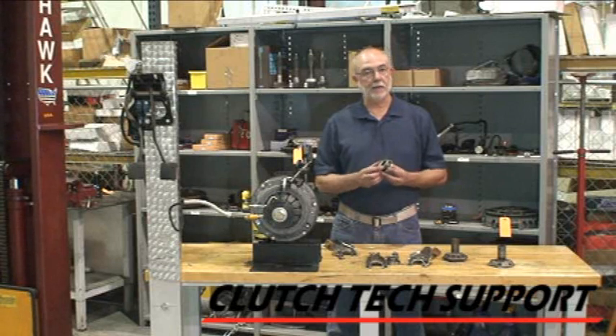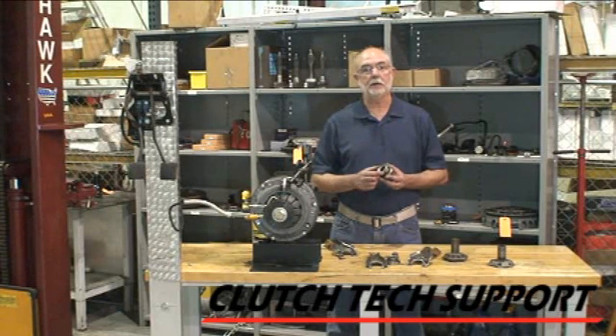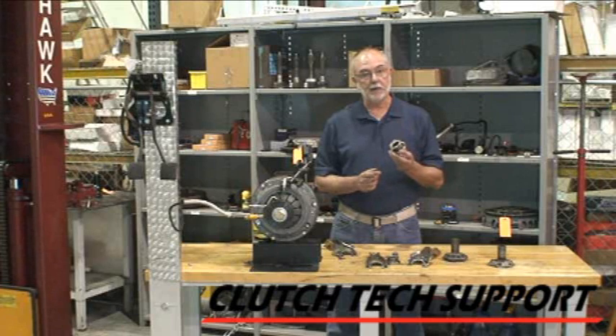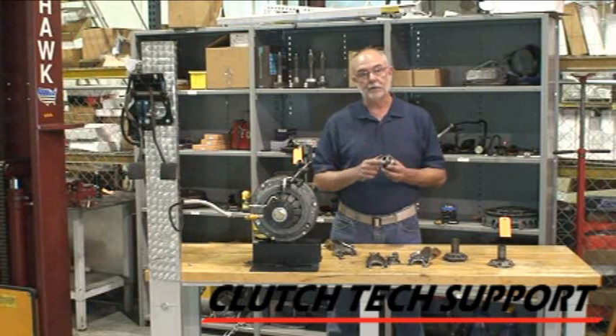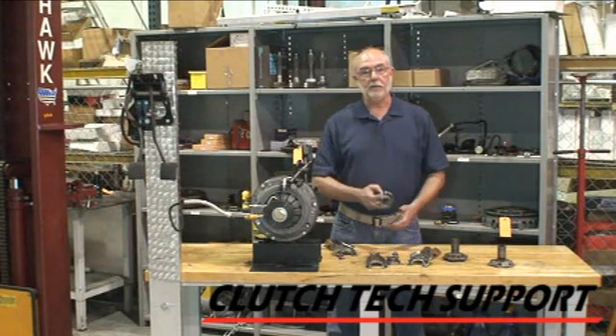Make sure you're going to use the fork. The flange on the back of this bearing preventing you from installing it wrong — that's a real solution, and it'll make your next GM or Chevrolet rear-wheel drive installation go a whole lot smoother. Because if you put the bearing on the fork wrong, you get to take the transmission back out in order to put it on there right.